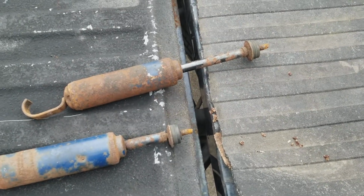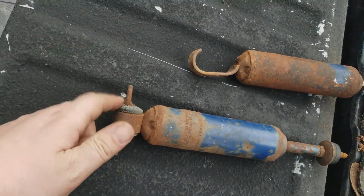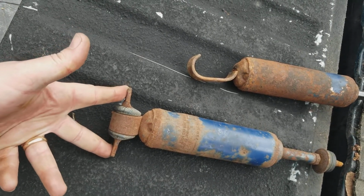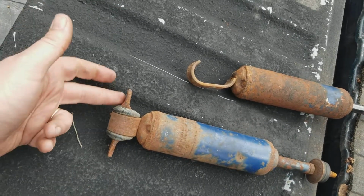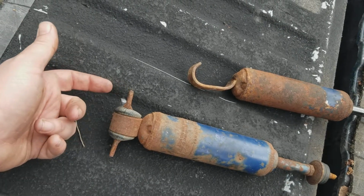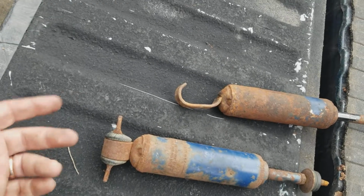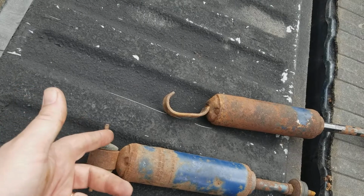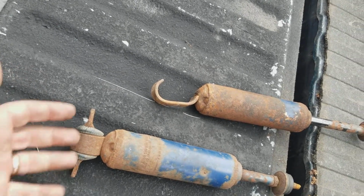Well, I finally got around to replacing it, and that was an odyssey because the bolts, I don't have this piece of hardware for that because it's gone. The bolts that held this one on had been in for so long, they basically had become rust welded into the lower control arm assembly. And when I put just a socket on, after coating it with penetrating oil, when I tried to back the bolt out, I got about a turn and a half out of the bolt before the top of the bolt busted off. And I had to weld a washer onto that little stump, then weld a nut to that washer, and then apply a bunch of heat and swear at it a couple times, and I finally was able to get it out.